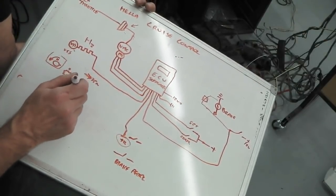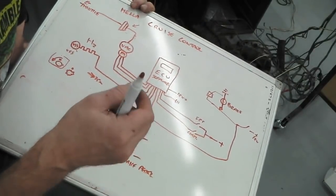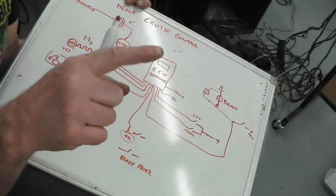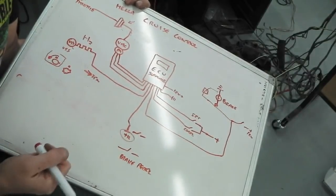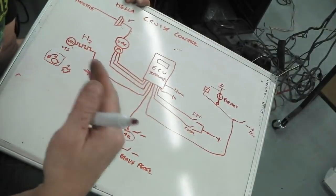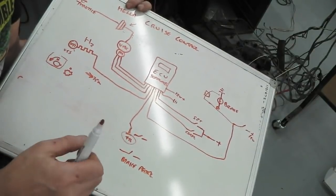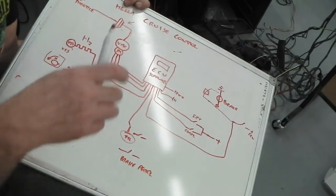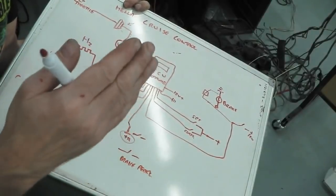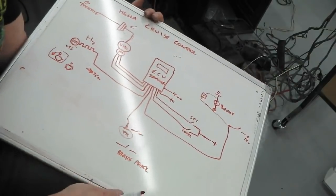Faster you go, and it's going to be so quick you actually physically wouldn't hear it, but you see it on a screen because we've got a screen wired up that can visually represent this fast pulsing of 12 volts and display it on a screen down to like thousands of times a second. I can set the sensitivity and we can see things that are happening really quick. So if you had to test your speed sensor on the bench with putting it on an electric drill or whatever, you can put this piece of equipment that monitors it and shows you a slowed down version of it. Basically slows everything down so the screen will display. It's called an oscilloscope and it can be used for all sorts of things.